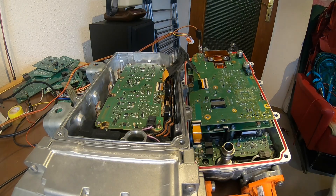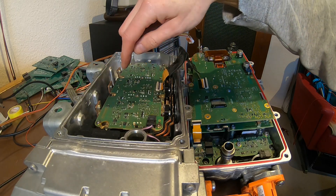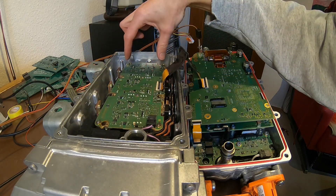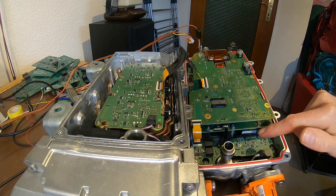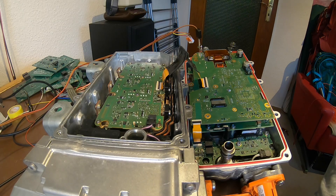Here it is all opened up and I'm playing back CAN messages to it right now — it's live. On the left side we have only the inverter parts: the IGBTs on the bottom layer being liquid-cooled, the capacitors all the way at the bottom, then the gate drive board connected with flat flags to the main board. Below the main board we've got the DC-DC converter board. And then in the front we've got the exciter board, which has an H-bridge configuration. I'm not sure if they vary the polarity of the exciter winding — they could in theory.